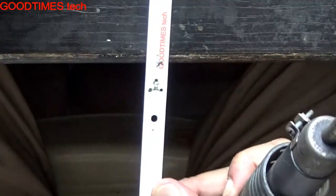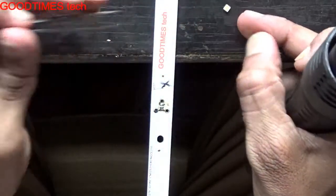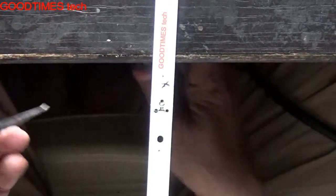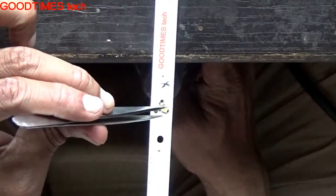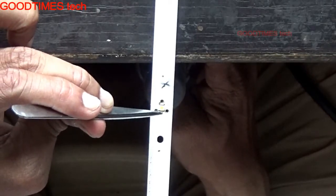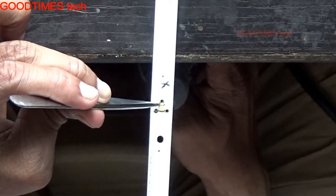We will fix one more LED which we had removed earlier. Check the polarity — it's very important. Also make sure the blower temperature is not too high. If it is too high, it will burn the paint on the surface and the paint will darken.